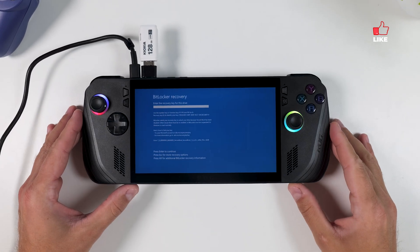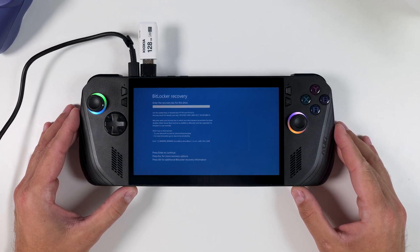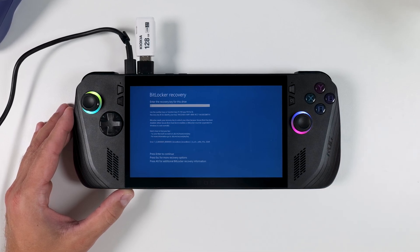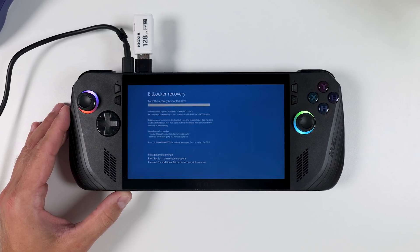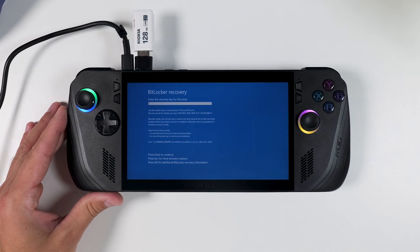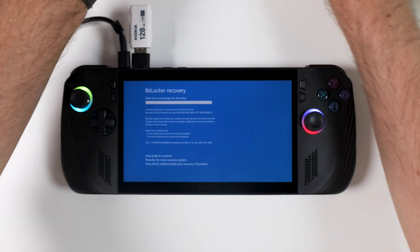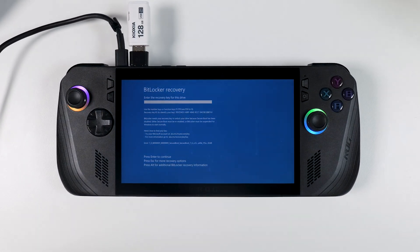Now, if you — like me — are suddenly hit with a super annoying BitLocker Recovery blue screen, don't panic. Unfortunately, this means we need to take a quick step back. The short version is Windows has locked the drive for security reasons. To get past this, you'll need to boot back into Windows and unlock it from there. Once that's done, we can jump right back into the SteamOS installation process. If you're lucky and don't get the blue screen, you'll see a pop-up asking which boot method to use — just select your USB stick and move on. But if your Ally boots straight into Windows instead, you'll need to restart and once again hold Volume Up and Power to get back to that boot menu. The rest of us are dealing with BitLocker first.